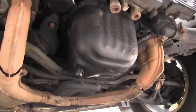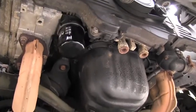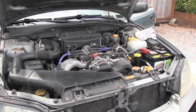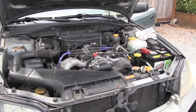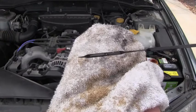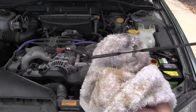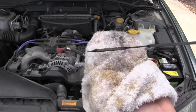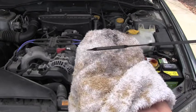You can see there are no leaks — everything is good. I will let the engine run at idle for approximately one minute and then shut it off. After waiting at least five minutes I'm ready for my final measurement. Hopefully this is what you will see on your dipstick — that the oil level is touching the top mark, which shows full.